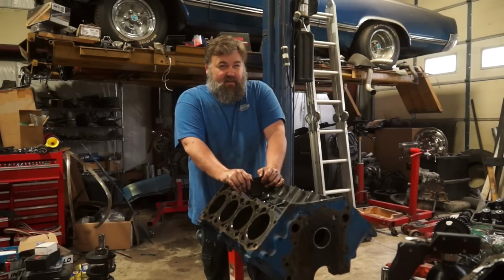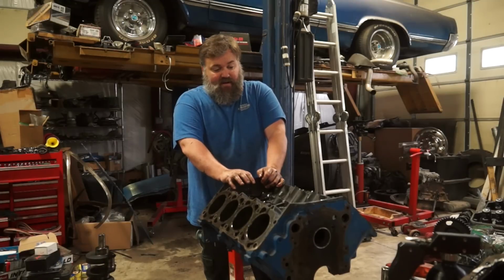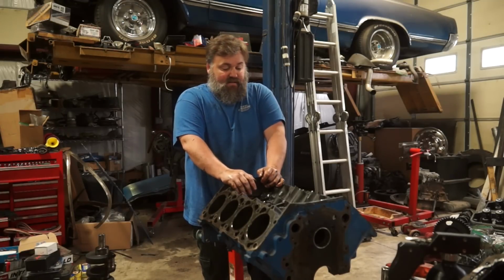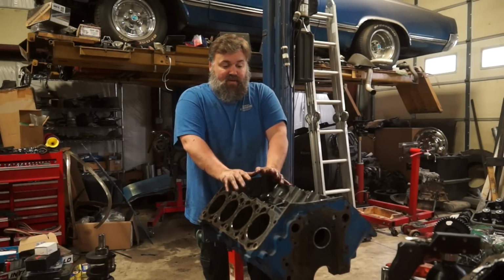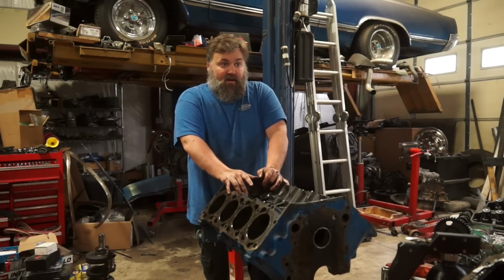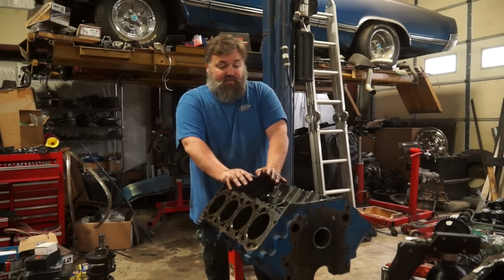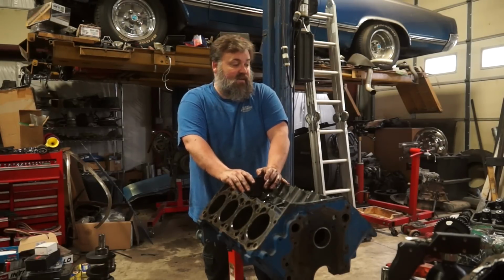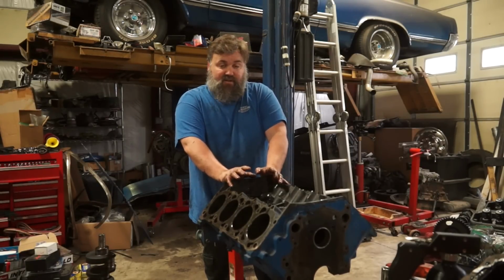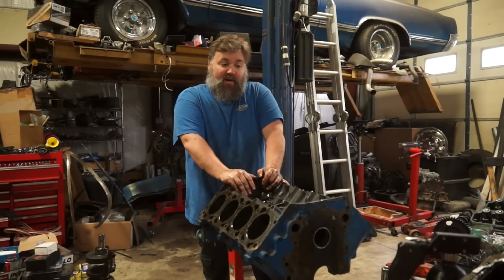I think I've done two of these so far. What we're going to do with this motor, honestly, I don't know. I just wanted to get this one torn down. I've had it sitting back here on an engine stand since we put the other motor in the other AMC AMX. But it could be a good candidate to get the other number 2 AMC that you guys have just recently seen back up and running. If we can get this block machined and put back together again, I've got rods. If the crank is okay, we've got a crankshaft. We've got a couple things that we could do, kind of a budget 304 to keep it moving. And then we can sort out everything else in it while we're working on a bigger, badder motor for it.